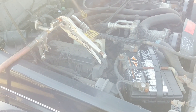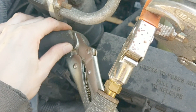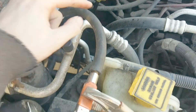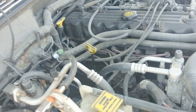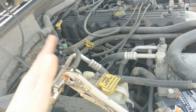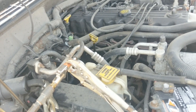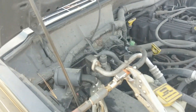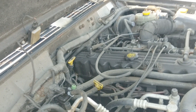Here's the one-man do-it-yourself backyard mechanic evap tester. We got one vice grip to hold the airflow - I don't have a proper hose clamp, so I found the biggest one I could find to block off the fresh air vent a little bit. There's still air leaking out of it but a little less. We just got the tube from there to there, and you keep turning the pressure up until you can start to hear a little leak. You don't want to go very far - this isn't supposed to have a lot of pressure on it. This thing was hissing a little bit, and I figured it was something down below, so let's go down there and see if we can find anything.